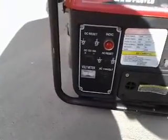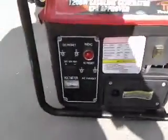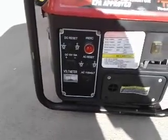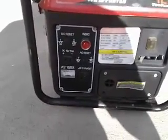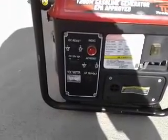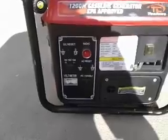I don't use the 12-volt direct current, but you can plug into it here. What I did was take a regular extension cord, bent the prongs, then cut off the end — you can tie that directly into a voltage regulator or a DC charger. Don't go directly to the battery with it because it's unregulated voltage and you could spike and burn out your battery. Don't do that.